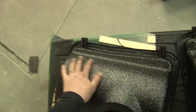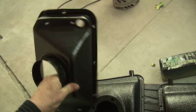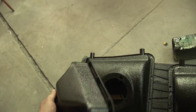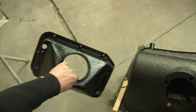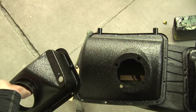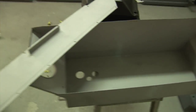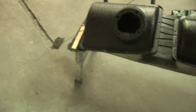This piece covers the heater core box. I do the inside and outside of it because this way it'll last forever. The rubber coating with the epoxy — it's etched and applied — won't ever rot. You could have water leakage into it and you won't have to worry about it again. The same thing will be done to the inside, and then it gets the foam insulating pad.